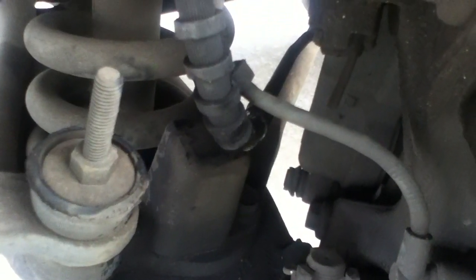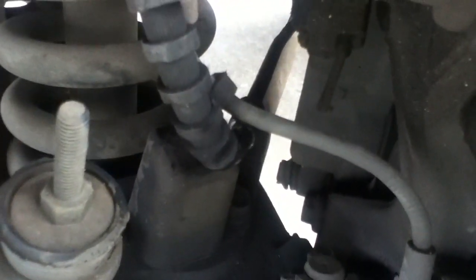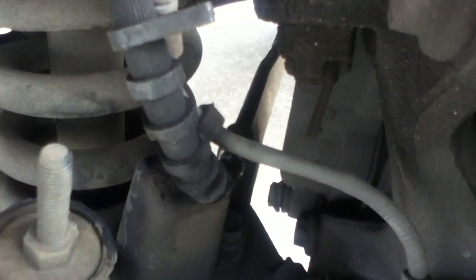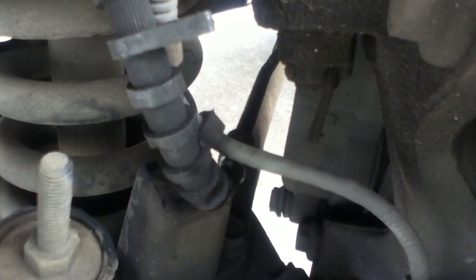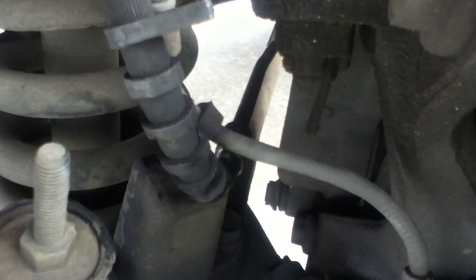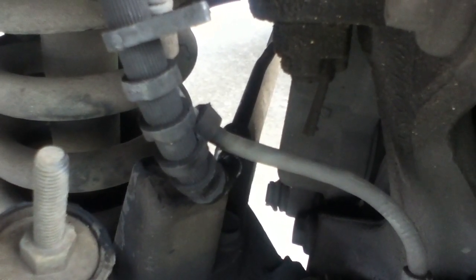There is obviously an emergency brake system in this vehicle, but it's that ratcheting thing that automatically engages. When this happens, you do still have rear brakes, it's just that you're going to be losing your brake fluid like crazy, and they'll very quickly fade to the point where you have very little braking power. I wasn't carrying a significant load by the time I was on my way home, so it didn't become an issue. The brake line itself is something that apparently a lot of local parts stores won't stock.